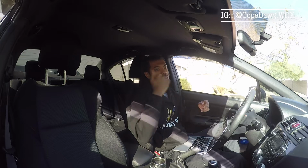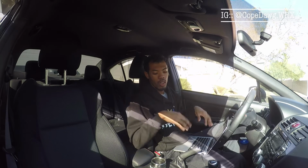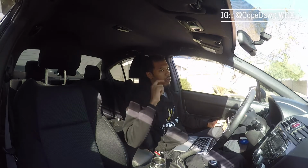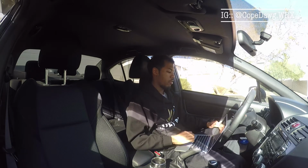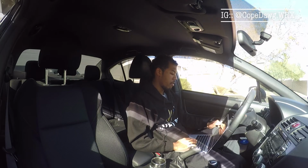I'll do a pull, get off the exit, get to a gas station, and send the log to Ron. He shoots one back like 10, 15 minutes later. Hop on it, warm the car up, obviously, do another pull, stop at the next exit, do it again. So sometimes you can get like 4 to 5 maps done a night, depending on how busy he is. So I'm gonna try to do that. We're still tuning for the 91 before we put in Flex or the E85 and go from there.